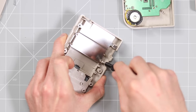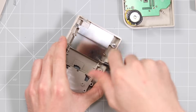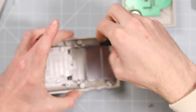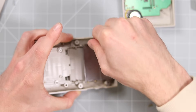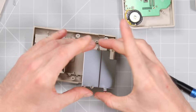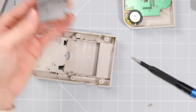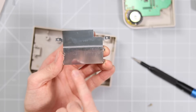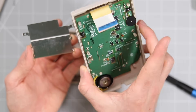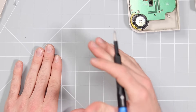The other thing we'll need as well is this little metal housing, so I'll go ahead and remove that too — that's just four Phillips screws, a very straightforward device to take apart. It's a really good one to build up your confidence with doing any sort of work. I'll give that a little wipe down as well, and actually it is in really good condition. I would say this Game Boy probably hasn't seen much use, so I'll definitely keep the shell for a future restoration.